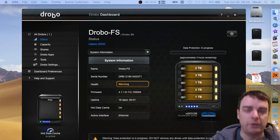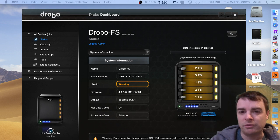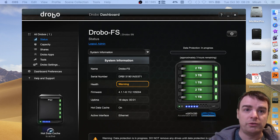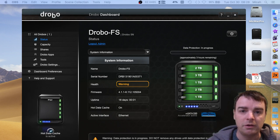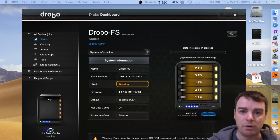I want to do a little video about TimeMachine and Drobo units. I thought I would do it because I've had issues with TimeMachine backups corrupting several times. I think I found out the actual cause of it, and to save you time watching three to five minutes into it, the issue is basically switching between your Cat5 network jack versus Wi-Fi.